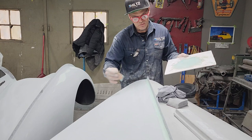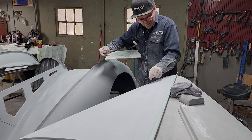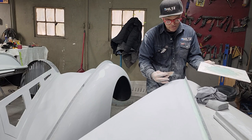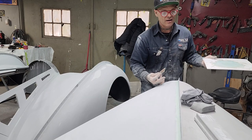You won't affect anything. Like I said, if you have a bunch of body fill and you have a pick there and a pick there and a pick there, and you come in and swipe that little pick, and that little pick, and that little pick before you prime over your body fill, when you sand that, you're going to make your body fill wavy again. So generally, this is what I like to do. If I have a pick or a pinhole, I like to prime it. If it's straight, mind you, I like to prime it and then hit that pick afterwards, because I have that shell of the primer to stop me from affecting the body fill that I have on the car. So I hope that makes sense.